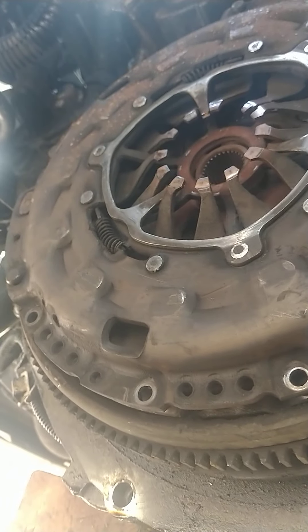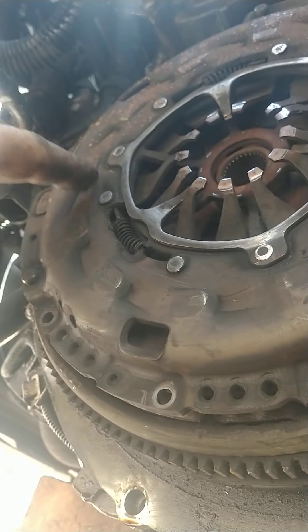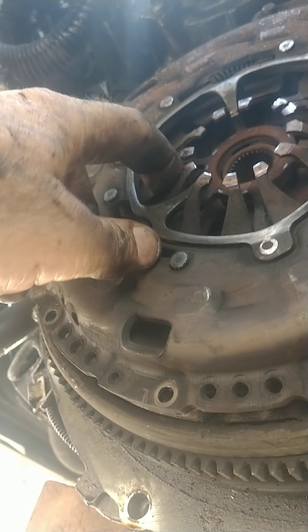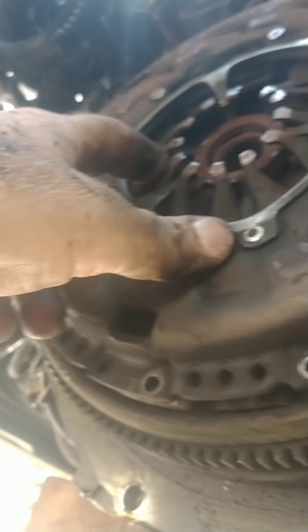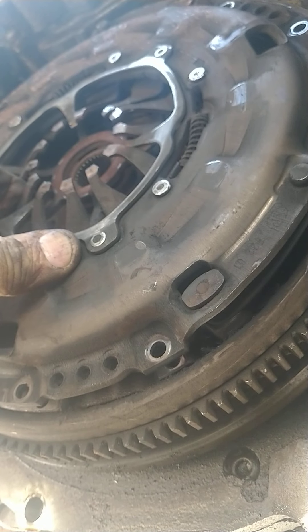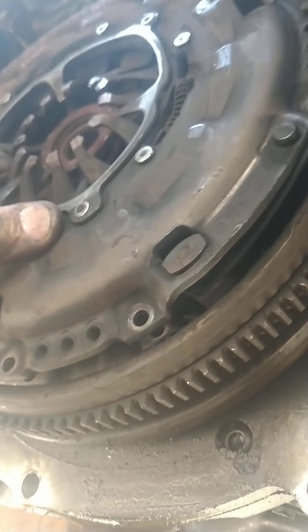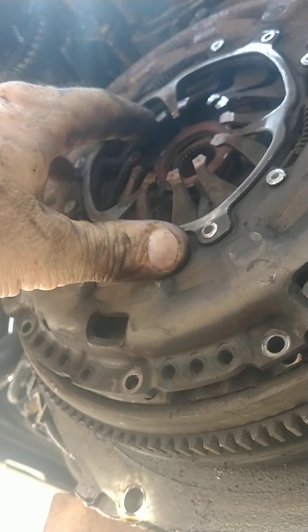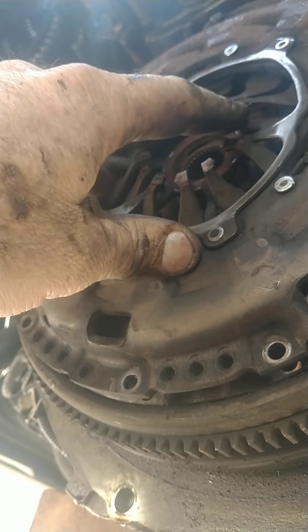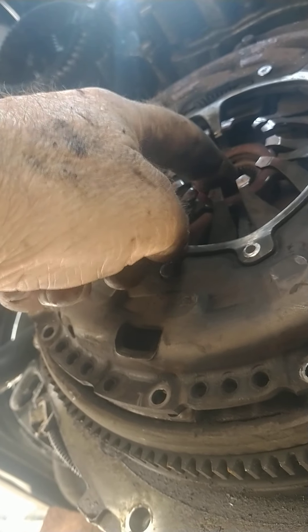Something was rubbing. I think this had symptoms of a disintegrated clutch. You could put it in gear when the engine was not running, or if you slightly rolled the wheels, but once it was running and you tried to push the clutch, the clutch plate just kept on spinning, so of course it wouldn't release.